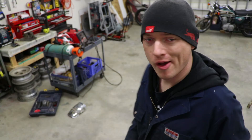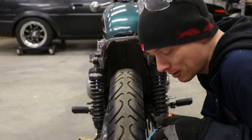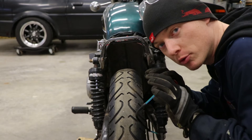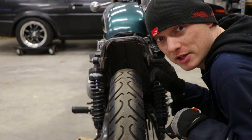Lovely. I'm going to modify something on the original frame — I want to use my new tail light, but they're a few thou too big on the diameter of the front thread to go through here, so I'm going to open these up. This is not wild and crazy — maybe I'm just removing corrosion, let's go with that. I'm going to open these up to around 405, which is the drill I have that's closest, so that I can pass these signal lights through and use these factory locations.